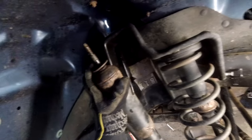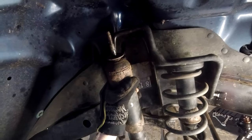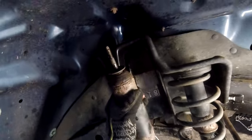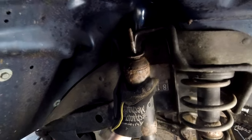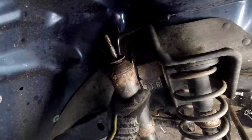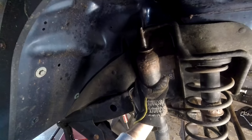So that's it — simple tip. I know a lot of guys like to just cut these off or torch them off or whatever. This is a method which I found works pretty easy, and it doesn't require a lot of special tools or technique. The hardest part actually is just cutting off that rubber bushing to get the vice grips on there. Get the vice grips on nice and tight, keep these threads as clean as possible, and that will help you a lot. But anyway, thanks for watching — I'll catch you on the next one.